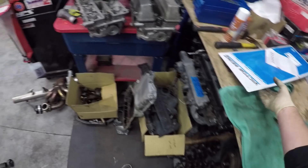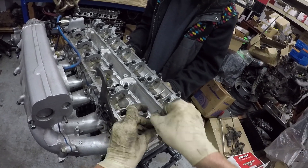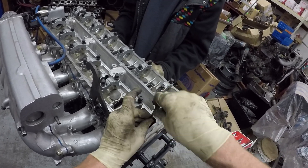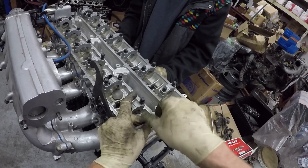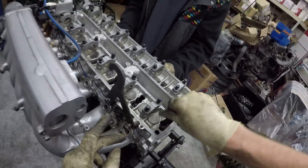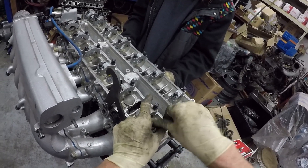I could run this without spraying it, but I just don't like it. I've never done it without spraying it — I'm too scared to try. I did one on a Honda that I didn't spray, and it leaked. It was leaking coolant out the front of the head. I had to go through and re-torque the head studs, and then it stopped leaking. I was pretty bummed out about that, for real. It's definitely not something you want to have happen.